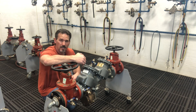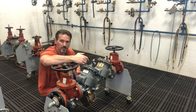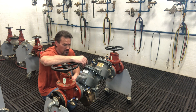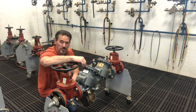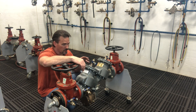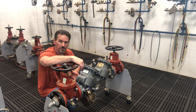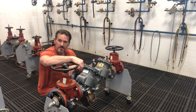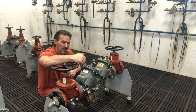It has two diaphragms — an outer diaphragm and an inner diaphragm. When we take it apart it's really important that we reassemble it properly, because if we don't, the relief valve might not function correctly, it might leak, or fail a test with your differential pressure gauge. We're going to shut down our backflow preventer, drain the body, remove the internal relief valve module, take it to the bench, disassemble it, and then reassemble and reinstall it.